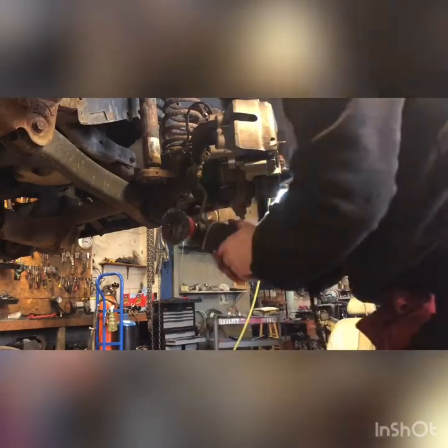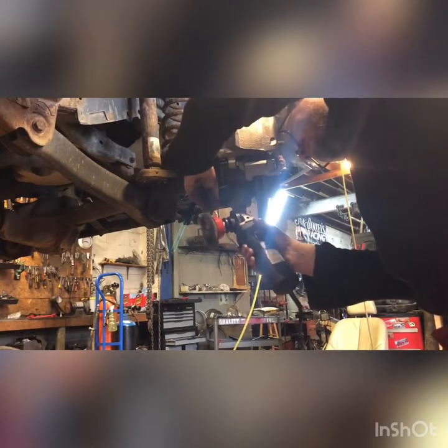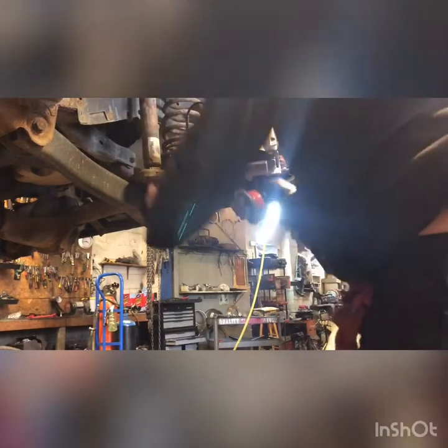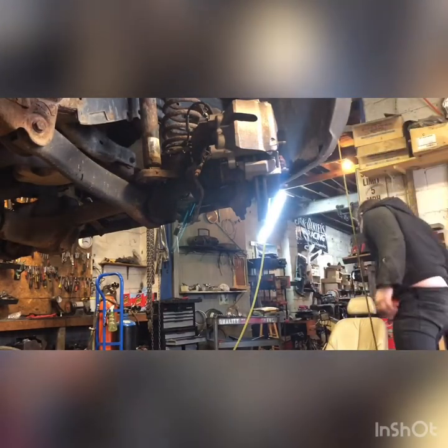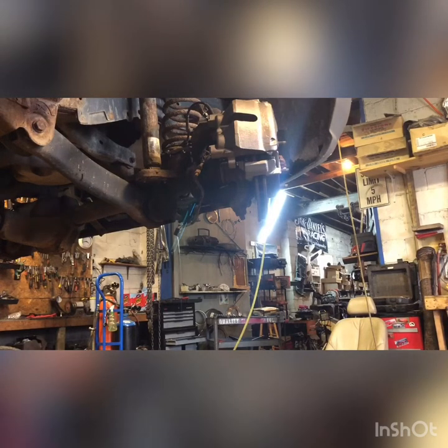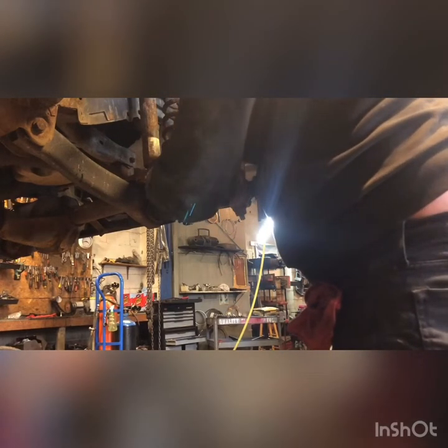It looks pretty nasty, the brake hose. Good. Kind of cleaned off that sealing surface. Get around to those brake hoses and rotors later. This is just getting pushed out. Just got to get the tires back on all the way around. Put one copper washer on the banjo bolt. Put it through the brake hose. Next washer on the other side. Line it up the same way it was on the old caliper.